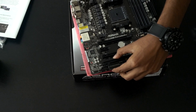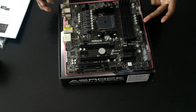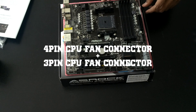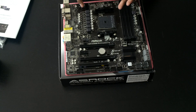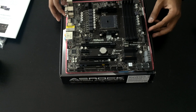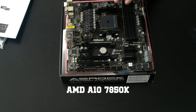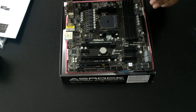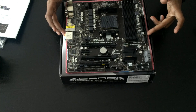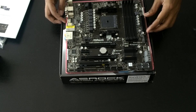There you have it — this is the standard motherboard. Everything else is pretty standard: we've got the power connections, two CPU fan connectors (one 4-pin, one 3-pin), the fan power 3-pin, and the 8-pin connection for the APU. We're going to seat the A10 7850K on this board and test some things. We won't be overclocking right now since I haven't got a good CPU cooler yet, but once that's done we'll run some overclocking and benchmarks.